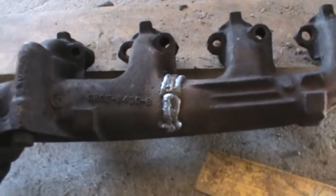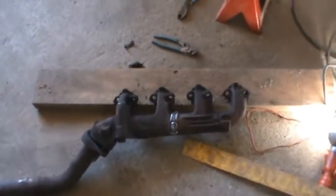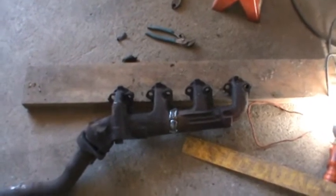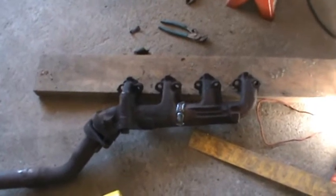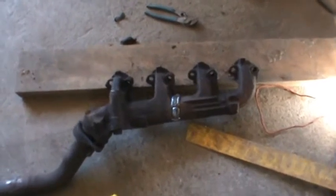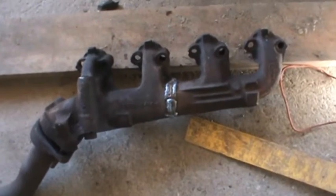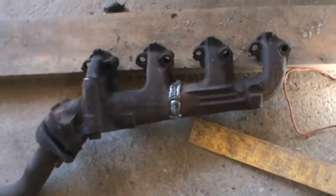I'm just trying to get this rat rod running, so I think that'll probably hold it. It wasn't leaking before, but that crack was pretty deep. But I think those 3 beads, one in the middle and one on each side, to kind of spread the load out, will be strong enough. I could tell when I was welding in the crack it was splattered, so there's impurities in there, but my outside beads were pretty decent, so I think it penetrated good enough to stick.